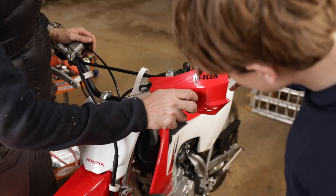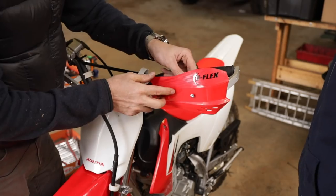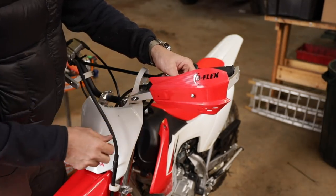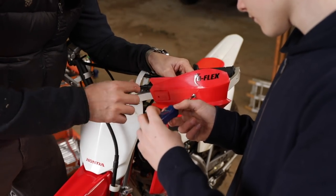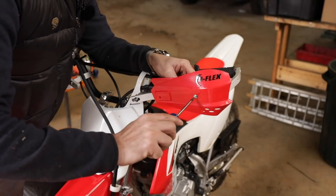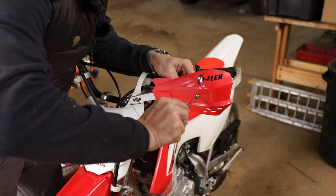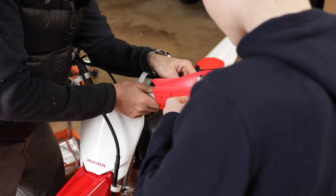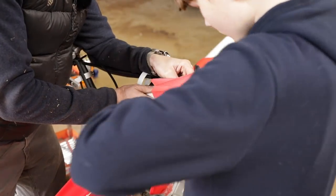Now, since you're going to be putting threadlock on there, you don't have to get it very tight. Remember that this is aluminum. And aluminum's pretty soft. So when you're torquing steel bolts into aluminum, you want to be careful not to over-tighten them. When you're tightening a Phillips screw like that, you want to lean into it, that last bit. But it's a poor design for a screw. If you don't push in there when you tighten, it'll slip out and strip the screw. Push in with your weight and turn. See how it slipped out there? It's got to be perfectly in line as well.